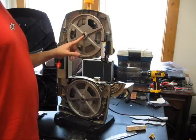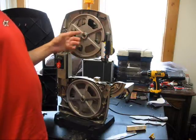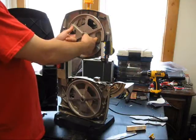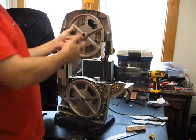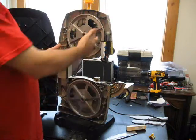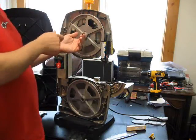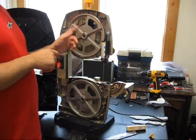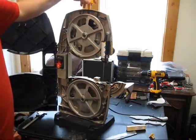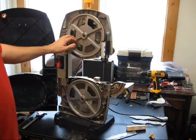When removing this wheel — when you remove the Allen bolt after taking the C-clip out — there's going to be a nut behind there that's going to drop down. When you go to put it back on, you'll be wondering why it's not catching. You're going to have to take the four bolts off of the housing behind there to access that bolt and properly remove the tension nut. It's not that hard if you're mechanically inclined at all.